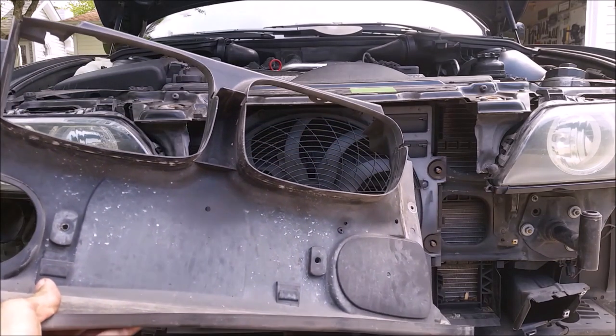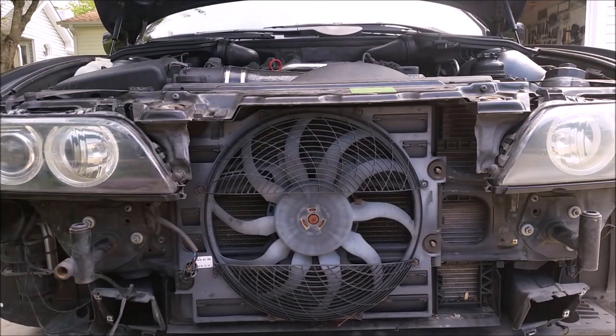I have the bumper removed and the shroud removed. You're going to have to loosen the headlights to get that shroud off — there are four 8mm screws that hold it on plus three pop clips across the top. There are also four 13mm nuts that hold this fan on. There are two different types of fans: pre-facelift and post-facelift. Post-facelift has three wires, pre-facelift has four wires — that's how you can tell which type you have.